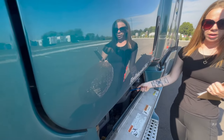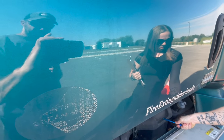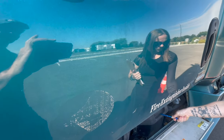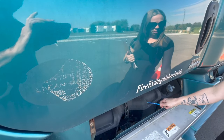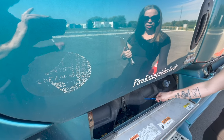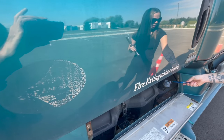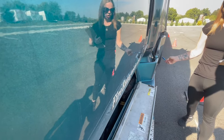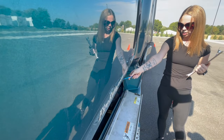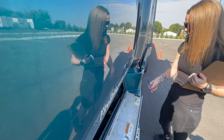All batteries are secure. All connections are tight. There are no signs of excessive corrosion. Cables and lines are secured, and the battery box is not cracked or worn, and the battery box cover is secured. My DEF tank and my fuel tank are properly mounted and secured. The caps are on tight, and they're not leaking from the tanks or the lines.